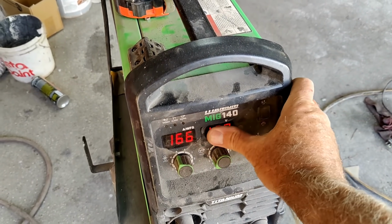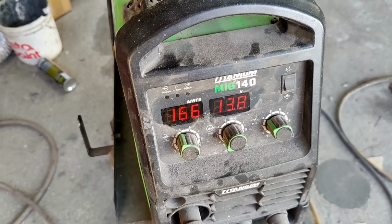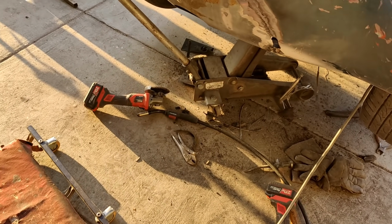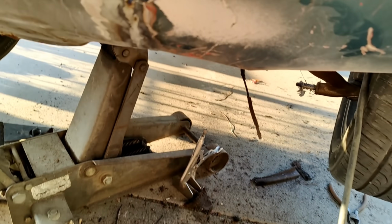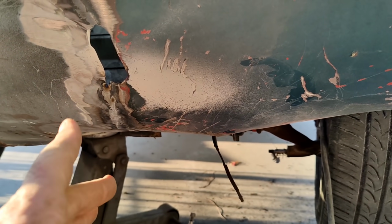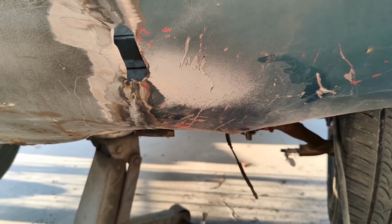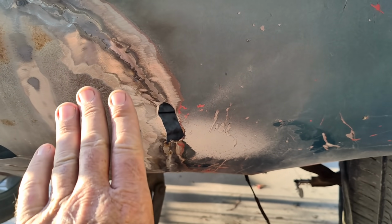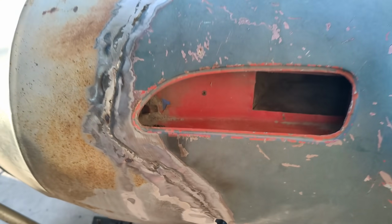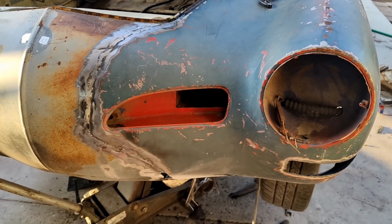Alright, so you guys with the Harbor Freight welder, that's where my settings were. I was actually able to do it at 12, going upward. It's a little raggedy on the bead. I know you should just do a spot weld and then cool it off and all that. I don't have the patience for that. So I always end up warping it a little bit. But if you finish it, fill it, it's all the same, good enough.